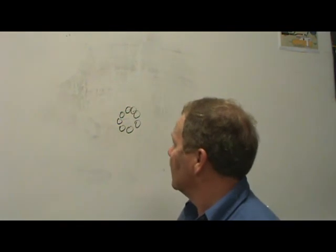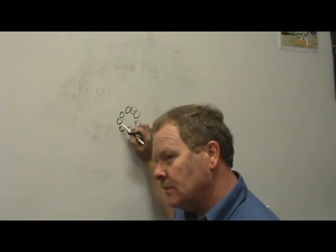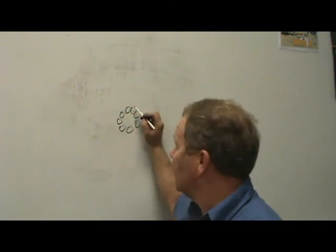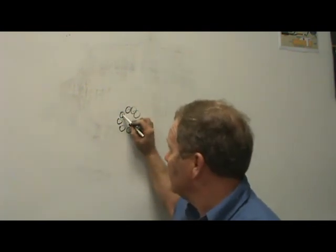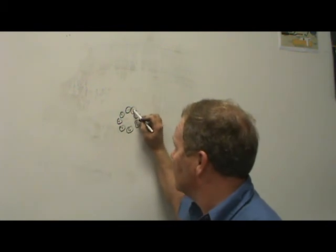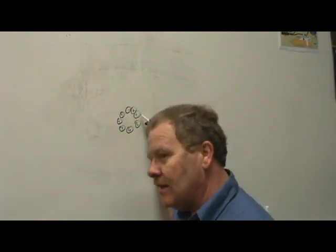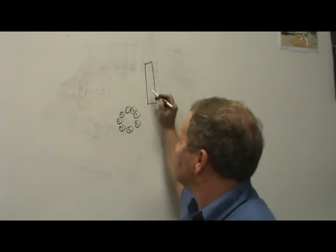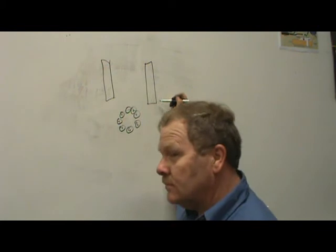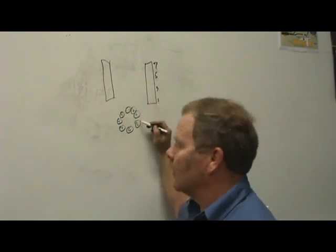Okay, that's eight spark plug wires, right? On a Ford, you're turning this way, right? And on a Chevy, you're turning the other way, am I right? But anyway, so you've got 1, 8, 4, 3, 6, 5, 7, 2. That's a Chevy. Now, where are 5 and 7 on the engine? Where's number 1? Right there. 3, 5, 7. Look at here.